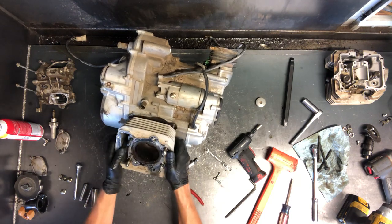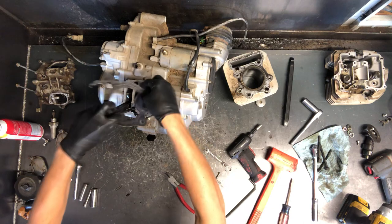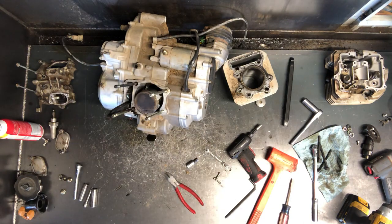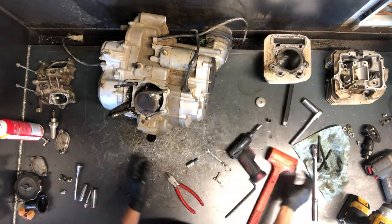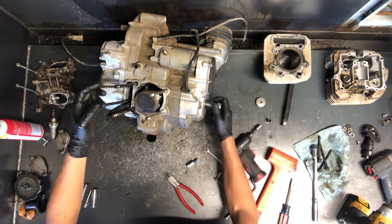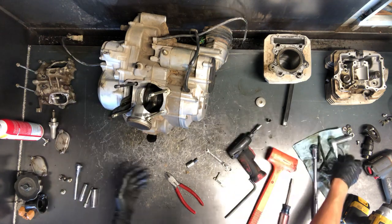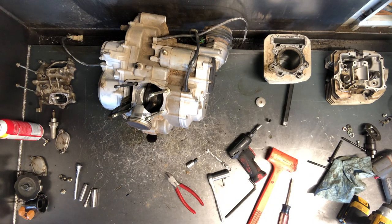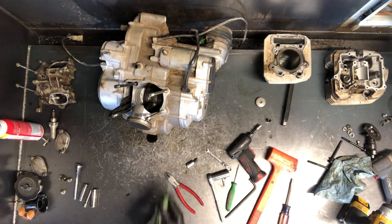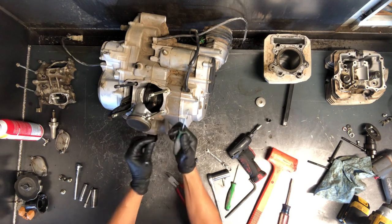The guide and cam chain can sometimes get in the way. There's your base gasket — that's a paper gasket. I'm going to spin this and hold the cam chain. You never want to let that cam chain drop down in there while you're spinning the motor because it could bind up and break your case. Just to show you how to get this piston off — I spun that motor up. Now I'm going to take a pick or a small screwdriver and get in here. There's a little groove beside your piston pin with a circlip in there that holds that pin in. Just kind of pry it up with an angled pick like that and you can push your piston pin through.